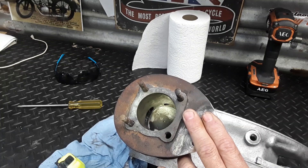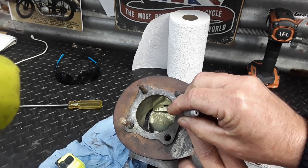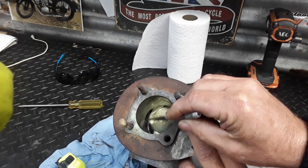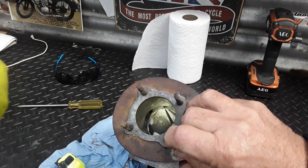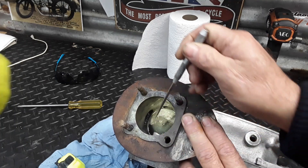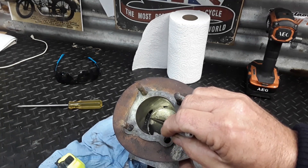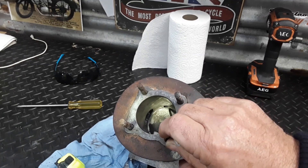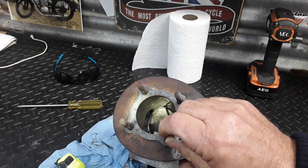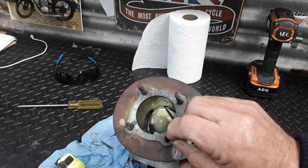We've put the cases and barrel back together. This customer wants a bit of a clean up — not full performance work. You can see the edge of the exhaust port there with the piston currently at bottom dead centre. We're going to die grind out this little bit here — you can see around the transfer there's a lip. We're going to take the bottom of that transfer down so it matches the transfer on the other side. We'll scribe a line through there and die grind the port levels nice and straight so we don't have this lip. We've already cleaned out the ports and transfers, then we'll max port to the case.